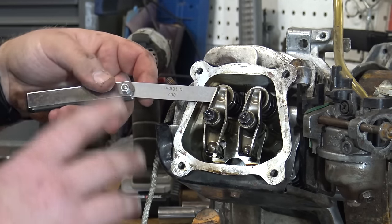There's a pin with circlips on each side of it holding the valve rocker to a cast ear inside the valve cover area on top of the head. I always take off the outside circlip because it lets you push that shaft inward between the valve rockers. Be sure to stuff a paper towel down in the bottom area of the head because the circlip can fall down in there and run down the holes where your valve push rods go — you definitely don't want that. So I always shove a paper towel down in there, then take out the spark plug and get the engine at top dead center so there's no pressure on either valve.